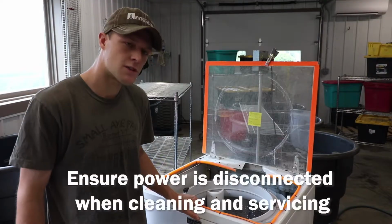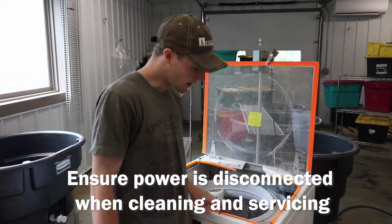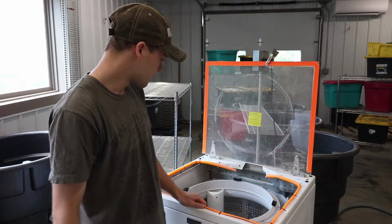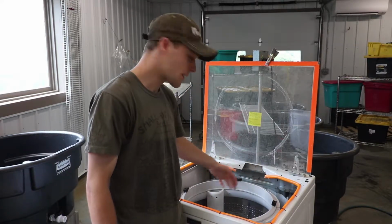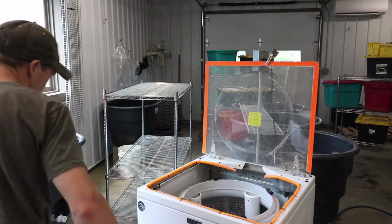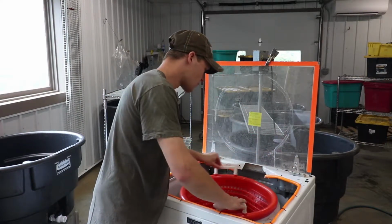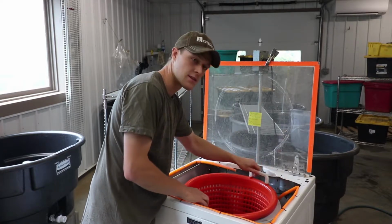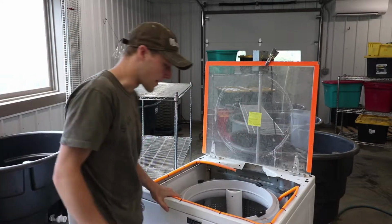So what's neat about this retrofit is that they cut the top off, or open, and so it keeps all this nice and smooth where you're touching it. However, we had to bend these tabs down on the back side because the inserts that we use, these baskets, were swinging around when the load got out of balance and slapping the edge of this and actually cutting the handle. So we had to bend those tabs down out of the way.